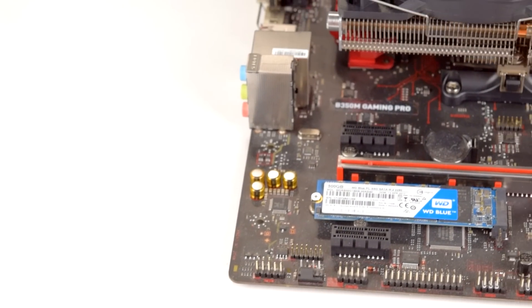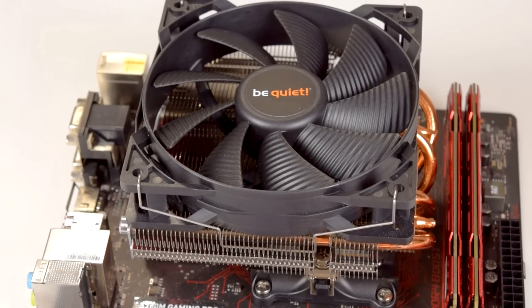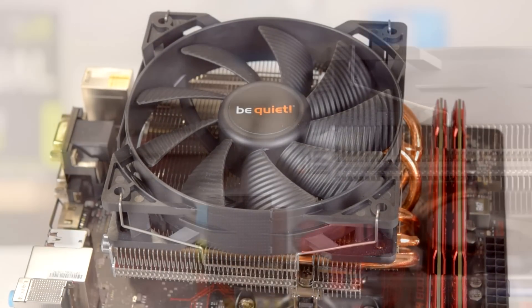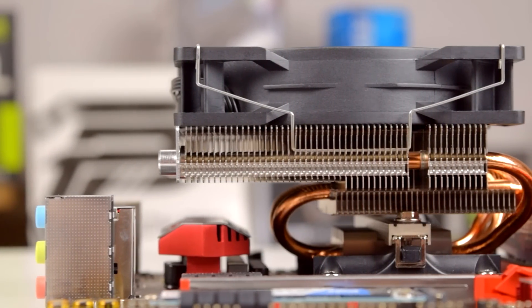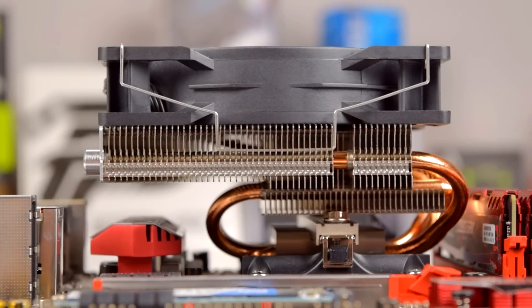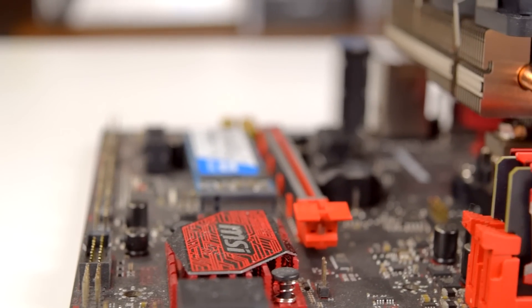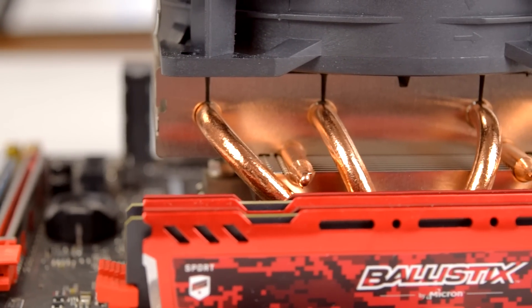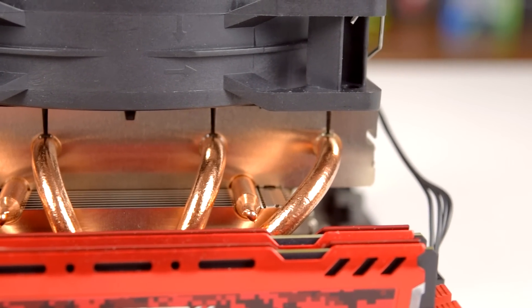On the plus side, installation was a lot easier than I expected. Low profile coolers by design block most of the socket, so some careful thought had to go into making it this easy to install. Second, and this is a very functional benefit, the Shadowrock LP directly cools the VRM for the CPU and, to an extent, all the surface level components on the motherboard. This might be the most underappreciated aspect of low profile coolers, because VRMs — especially those with low quality or poorly designed heatsinks — can get extremely hot without direct airflow.